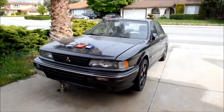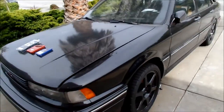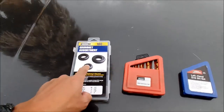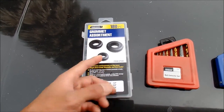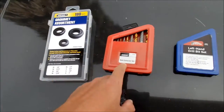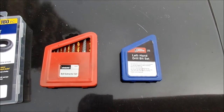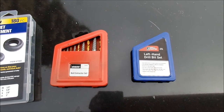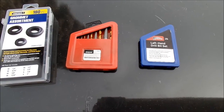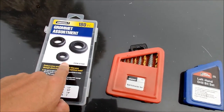Hey Lizzie Maker here. The car is pretty much almost ready to run. I have to go through the inside of the car a little bit to see if I have any parts left over. I think the strut bar is still there, but that doesn't need to go on for the car to run. I wanted to add grommets to those intercooler brackets so it has some vibration dampening — that way the brackets won't crack or anything. And I'm going to try to get that busted bolt off the crossmember. So I'm going to remove the crossmember today. I got a bolt extractor and left-hand drill bits on my drill, so hopefully we can get that done. First I'm going to get the grommets together.